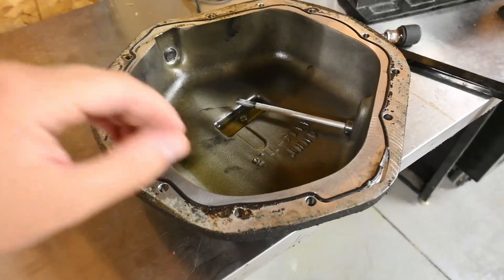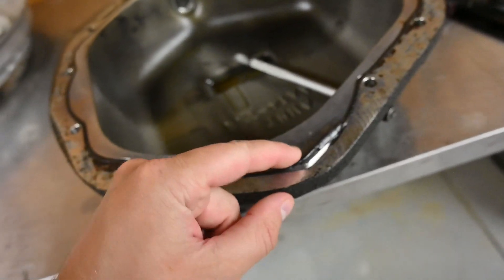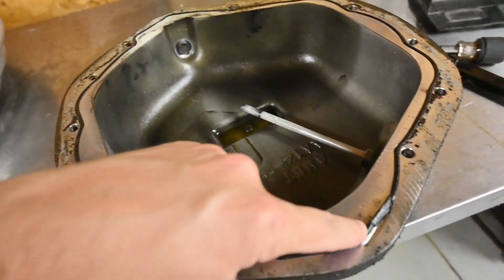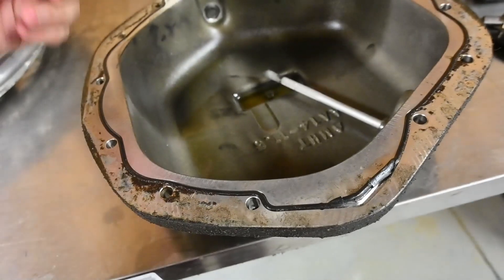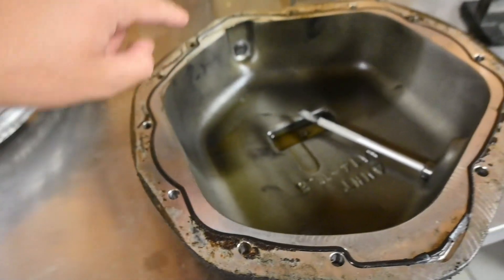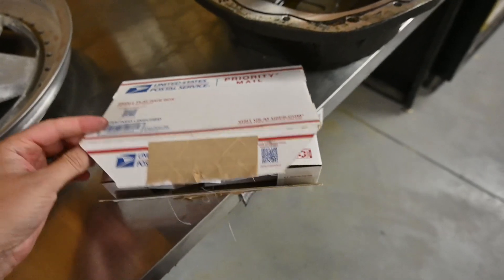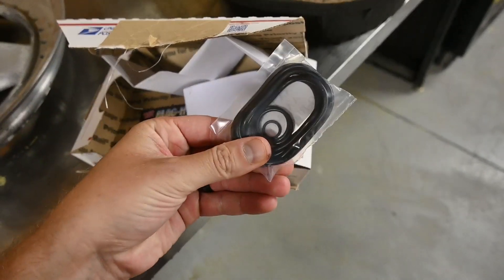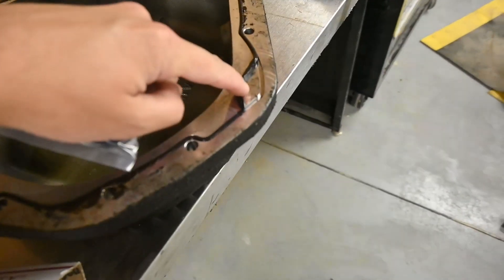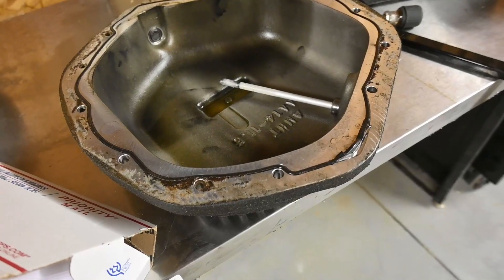With the back cover off, I can see what's causing the issue — it looks like the gasket came out of the groove when I tightened it up, because it's all flattened and messed up here. My guess is that when it's spinning, it's throwing fluid out of the top and it rides along this seal — you can see all the gunk building up here. That's why it's only a couple drips overnight. I went to Mag Hytec's website and they sell replacement gaskets, including for the drain and fill, so I'll get the new seal in there and fill it back up.